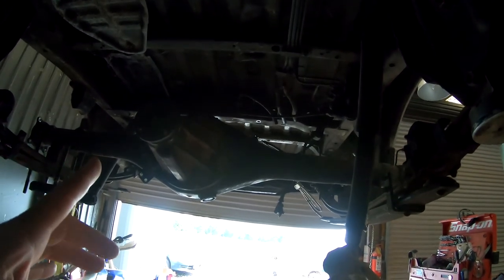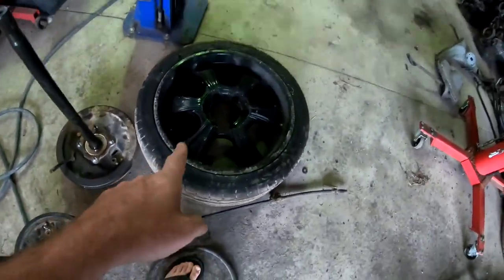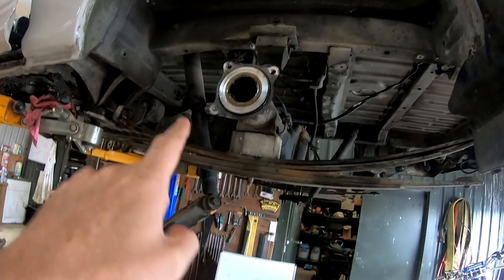We thought we'd sort the diff out and put an LSD in it. We're doing the engine swap, but we were working back here beforehand, mixing and matching axles. This van was a 6-stud, and the front brakes are now 5-stud, so we want the back to be the same. But it turns out that on the 6-studs Toyota changed the housings. We found out that Toyota changed the housing flange pattern to accommodate different axles — the diff head came out of a Hilux, so those axles are 30mm shorter than the HiAce ones.